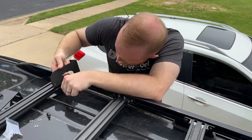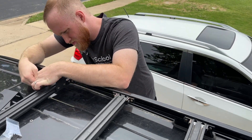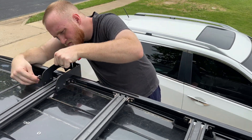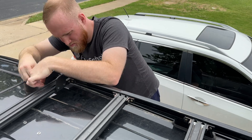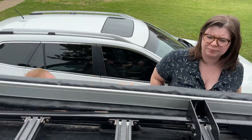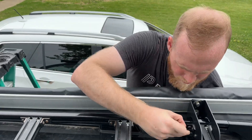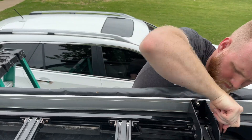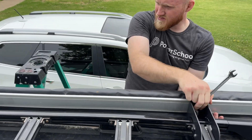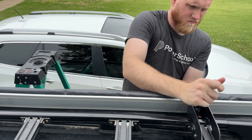My roof rack order had some additional T-nuts and I added some screws to that order in preparation for installing these. They're just M6 screws and standard 10-series T-nuts. I added some stainless steel washers because the screws are just a tiny bit too long, and they made the brackets extremely secure. My wife helped me get the awning mounted to the new brackets. The hardware for that was just what was included in the NAPA awning, and I added a washer to the back of each of the two bolts for each bracket to spread the load more evenly. A ratcheting wrench was an absolute lifesaver — especially for that lower bolt where you could not get a socket on it.